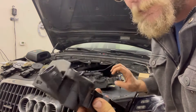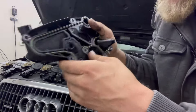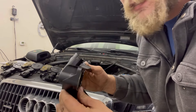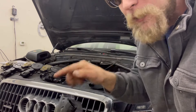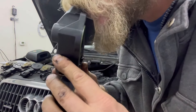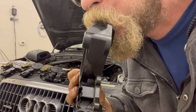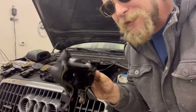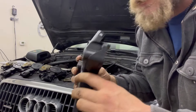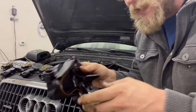Let me try another one. This one normally looks intact — I just cut it open to see what was going on. You can see there's a spring mechanism in that PCV valve right here. It pulls nicely. Now blowing instead of sucking — that one stops a whole lot better, there's a lot less airflow coming out, but there's still a very little bit. There's a lot more coming out of the flap on the first one. Let me try this next one — it just has the top missing but that doesn't affect the valve inside. It pulls nicely, but that one has a pretty big discrepancy in the valve.